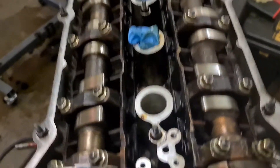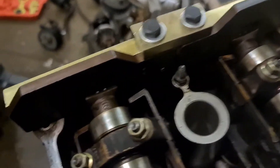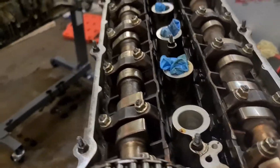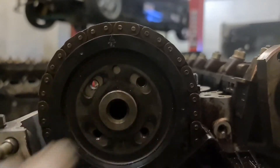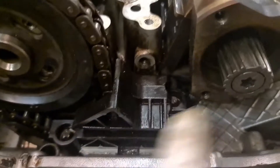Before doing this, obviously get them at top dead center — you know you're at top dead center by the front lobes facing each other. Also make sure you lock your cams in place with the correct tool. You can see there two dots and two dots facing straight up — that means you're in top dead center. I've put the exhaust sprocket wheel on, the arrow has to be facing straight up and these holes roughly in the middle. I've stuck the tensioner in, popped in the bottom guide rail and two E8 bolts — they're 10 newton meters each.